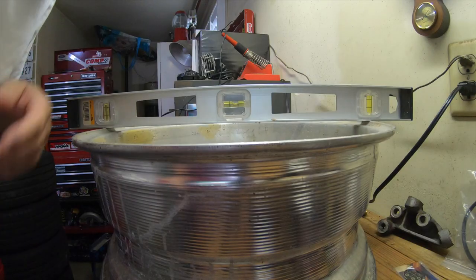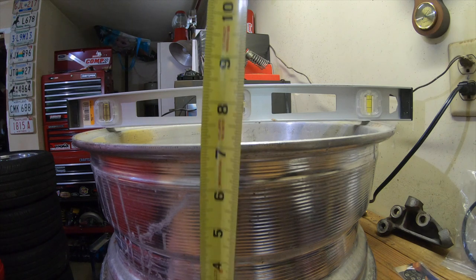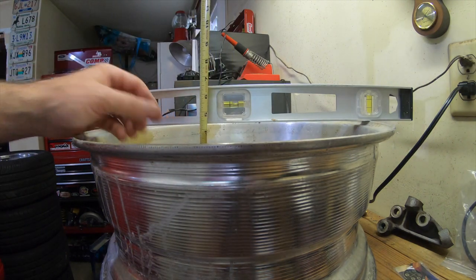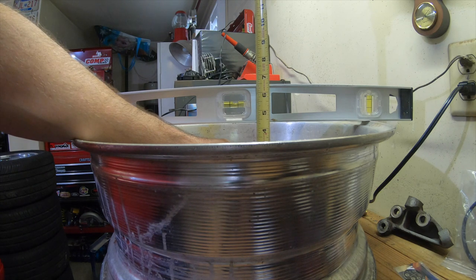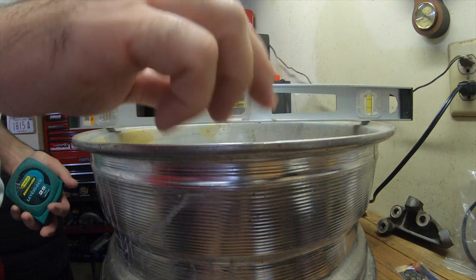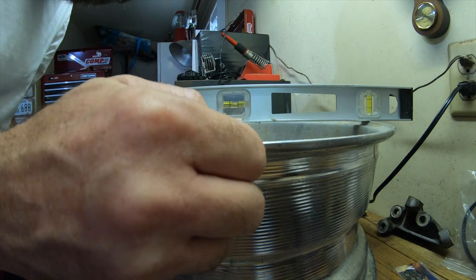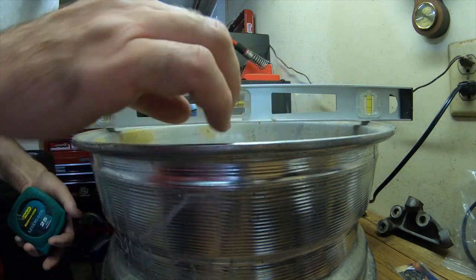Let's look at offsets and show what's different. Here we have the front wheel — a seven-inch wheel. From bead to bead, remember, it's seven inches. The backspacing on this one is four and three-eighths of an inch. So on a Saleen front wheel, the backspacing is four and three-eighths. There could be a slight difference in production as far as the lip of the wheel, and you also could have a wheel that's been repaired, which would change your backspacing distance. But either way, four and three-eighths — give or take a thirty-second.